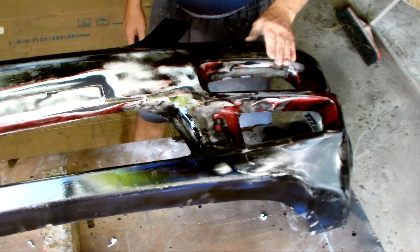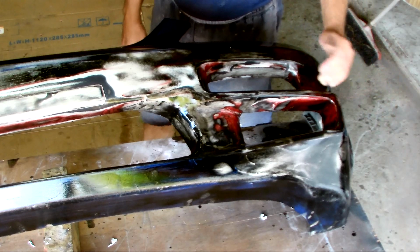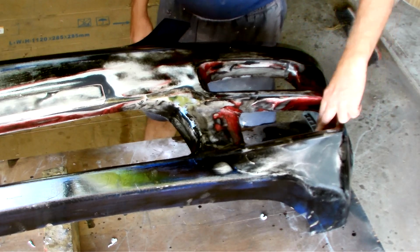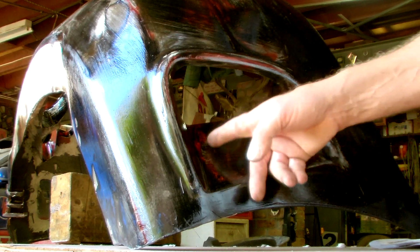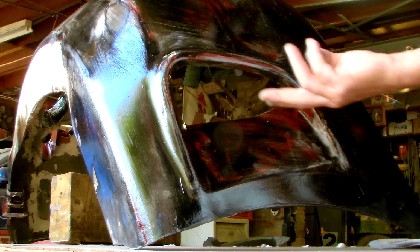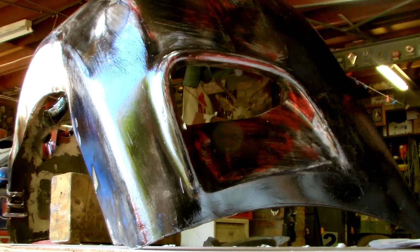These front scoops will be easiest to fiberglass over with the bar this way up, as the cloth will flow down into them. But in this position I can't fiberglass these side vents because the cloth won't stay up on the underside of that edge, it'll just fall down.